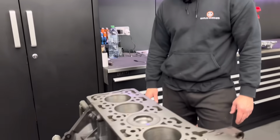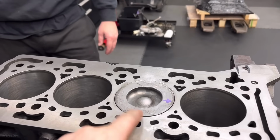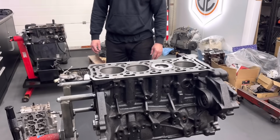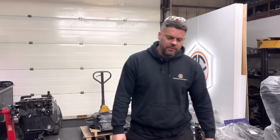And then I've just put one piston down the bore, and I'm going to measure, probably Monday now, the protrusion. But I've actually managed to find Ford's specifications for the protrusion. Really? What, the tolerance? Yeah. What do they give you? I can't remember, but I've got a screenshot on my phone. Okay. Very good. I'll be able to compare. It's all right, isn't it? But we only took about 3 or 4 thou off this block face, so shouldn't need much. No, not really. Well, that's good then, mate, isn't it?